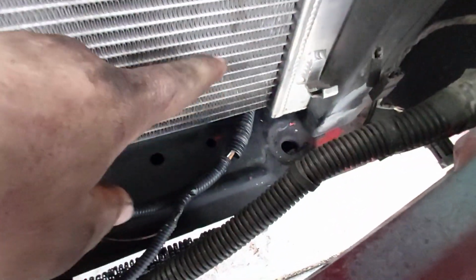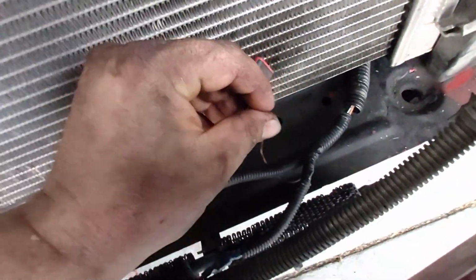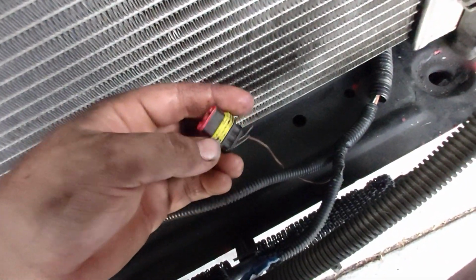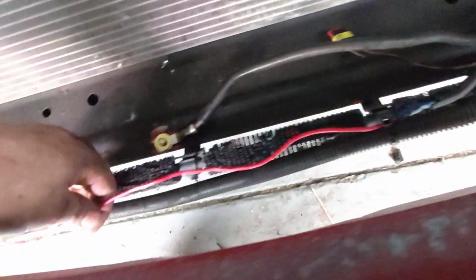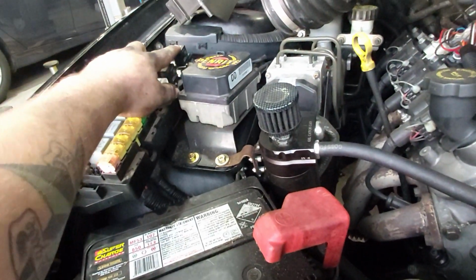The ground, so I sort of split the loom. Brought the loom underneath the radiator, insulated of course, you don't want that rubbing through. That plug I spoke to you about in the last clips, I found which 2 wires were the remote. You join those 2 into one, and then you run that one feed all the way up into the power trigger for your fuel pump.